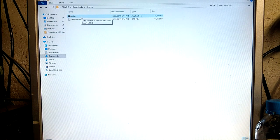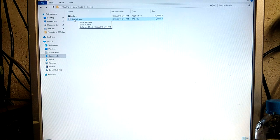In this bit, I'll be explaining my method of soft modding the Xbox. You don't have to use this method if you have a better solution, but I found this to be fairly simple. It might be outdated, but you don't need any extra things like a game or a USB converter or anything like that. You just need an old computer with an IDE interface and hot swap the hard drive.